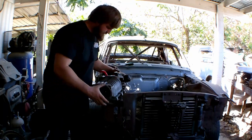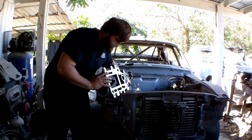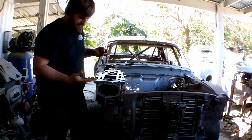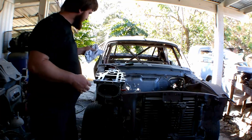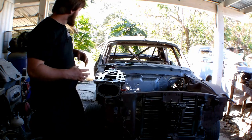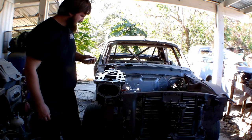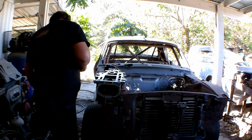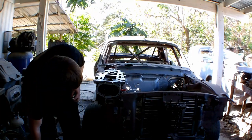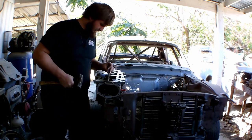Next piece is you take these gears off, which comes off with the blade. So you flip it over, and you knock off the gears and the blades — they're all one piece. You take a punch, or in this case my extension that I've used many times as a punch, and you go on the inside and the back of this piece here.